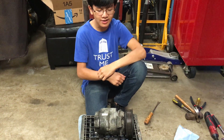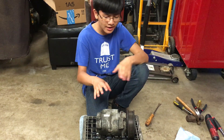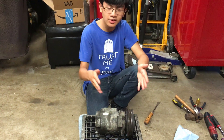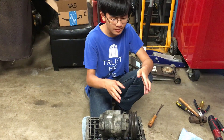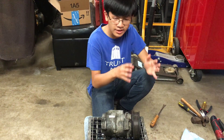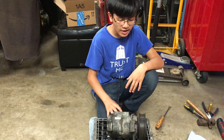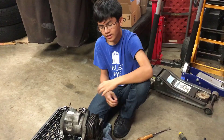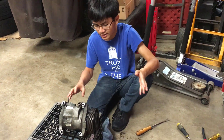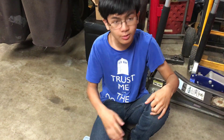If you've seen my previous videos on removing and installing the AC compressor, you know that I talked about how the AC compressor works — it uses an electromagnetic coil, and when that is turned on, it engages the clutch and that basically locks the pulley in place. In this video, I'm going to show you how to remove it and how to replace it. The reason we're doing this is that when we were testing it, we found out that the stator — well, the stator and the coil are the same thing — we found out that it was bad, so we want to remove it so we can replace it.